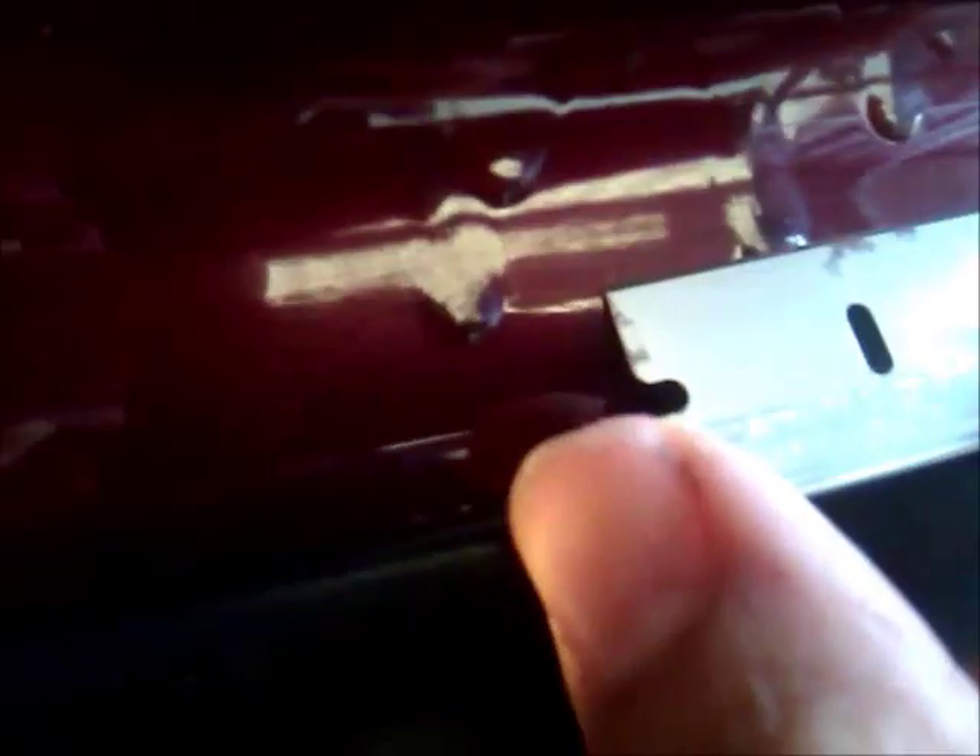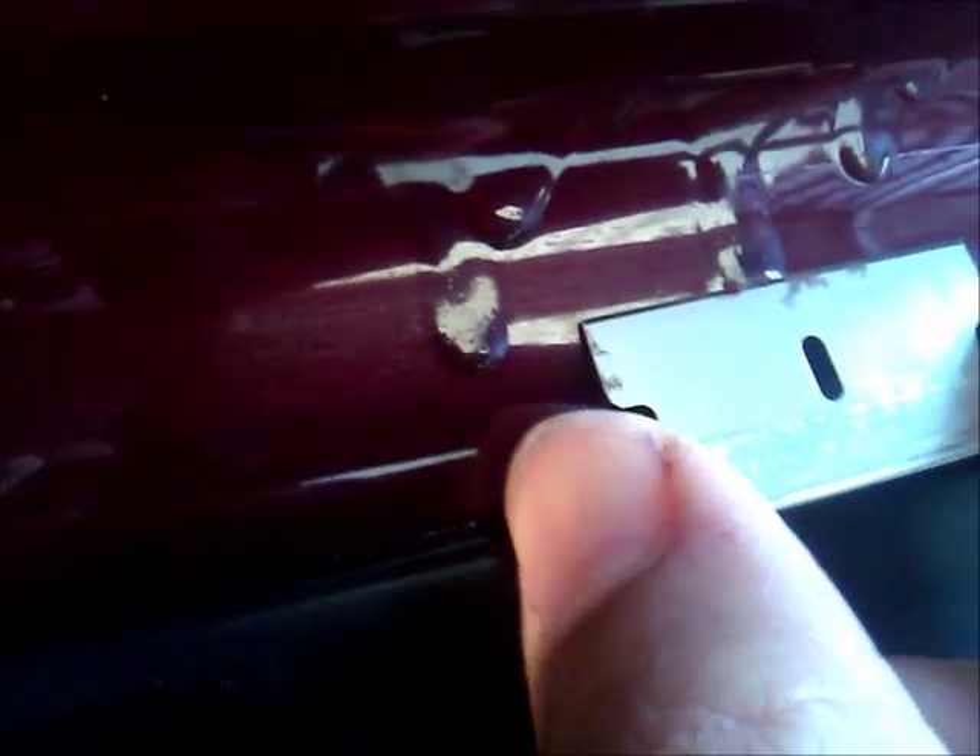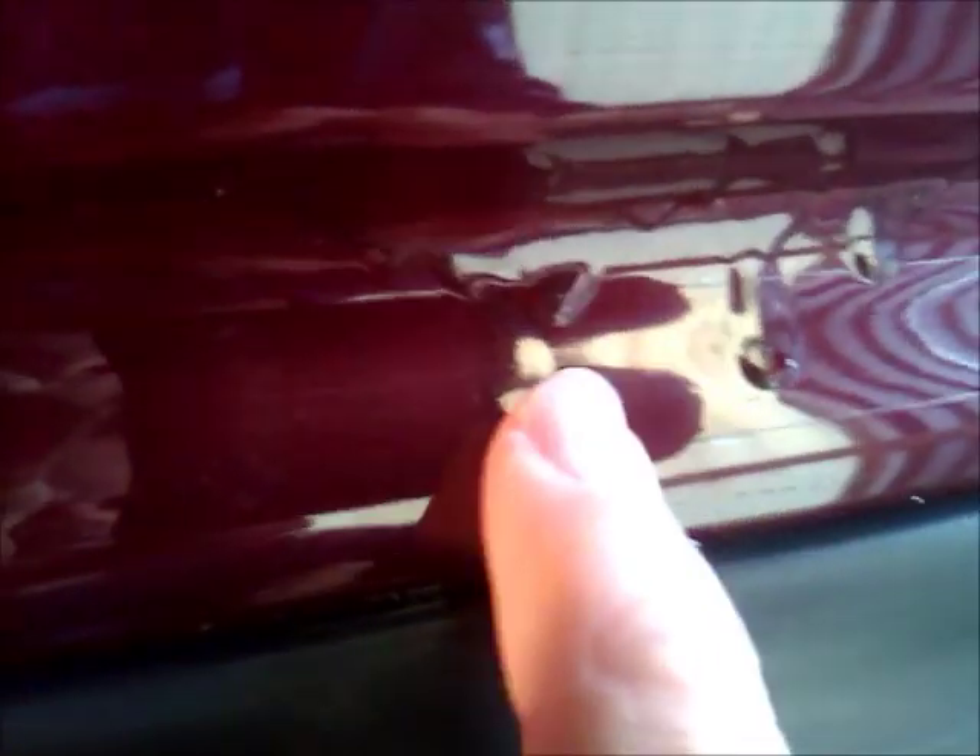If they're too high, you can take a razor blade and skim them off, but there's just not enough room here to really do that, so I'm just going to sand them down — it won't take but a couple minutes. Actually, the easiest way to fix these runs is take a razor blade and gently cut the tops off. I'll gently cut that paint off the top of each one of the big, easy ones — that will save some sanding time — and then we'll go with 320, 500, 1000, and we're going to wet sand.